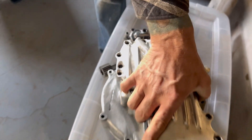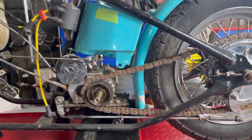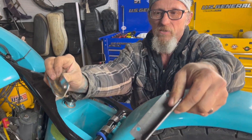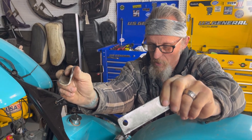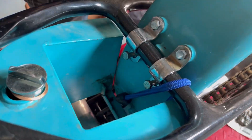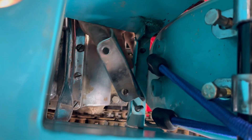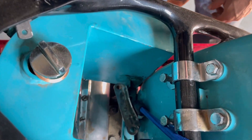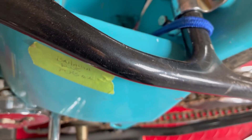When I started working through all those pieces and parts I was trying to figure out how this oil bag mounted because this is an aftermarket Jammer frame. I found pieces that were completely rusted - everything I've done on this bike I've put every nut, bolt, washer, and bracket in vapor rust, soaked it for 24 hours, then hit them on the wire brush. I figured it out piece by piece - this is what holds the back into that oil bag. This fender is pre-made with these brackets that bolt in here and down here. Those two holes hold that bracket to the fender and then this other bracket, just a piece of angle iron, sandwiches in between - and all that ties together to hold that oil bag. Kind of a cool setup.